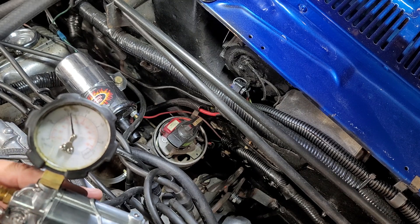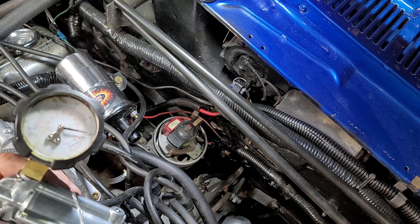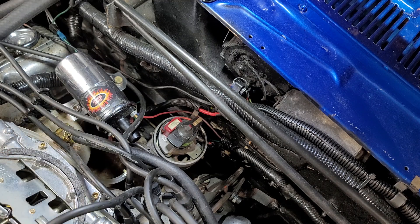It's basically using the vacuum of the engine, which would typically be at idle or at cruising at lower RPM speeds. The vacuum advance type of distributor will adjust its timing ever so slightly — it might adjust it 15 degrees, sometimes even 30 degrees, just for lower speed use and idling use.